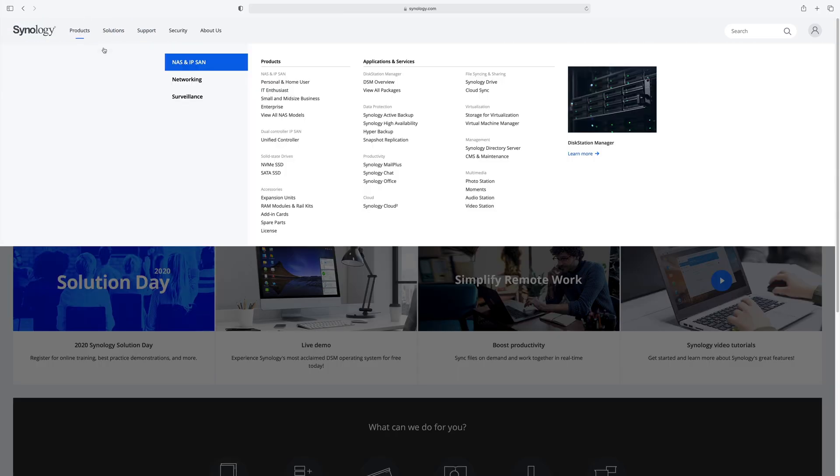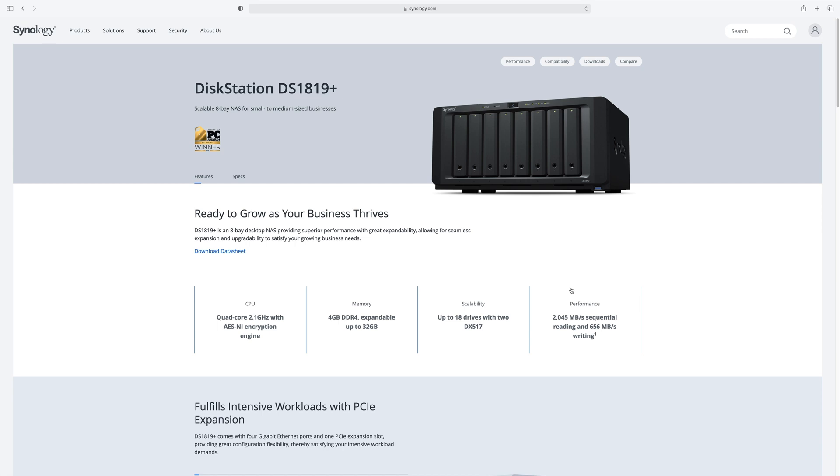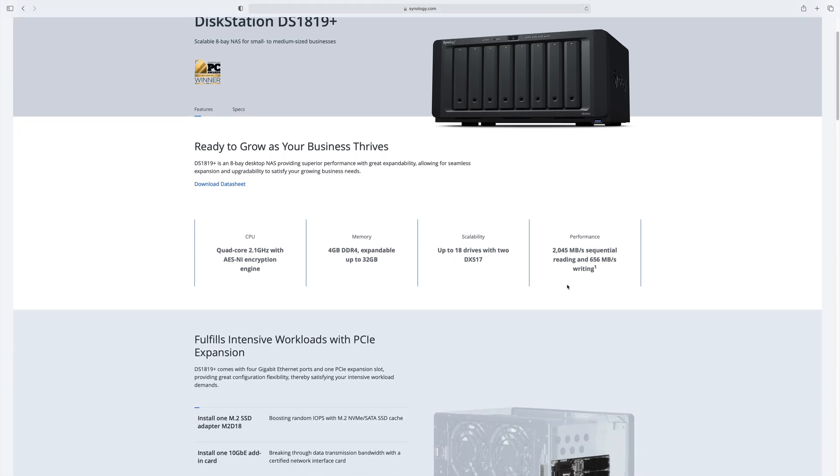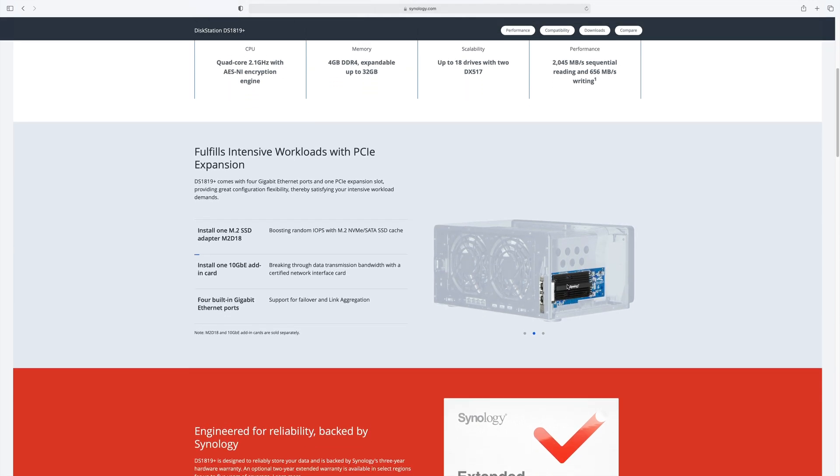What I'm going to go with is the Synology DS1819+. It's an 8-bay NAS with software that users apparently swear by, but most importantly, it can serve the computers at really high speeds. The iMac Pros come with a 10Gbps Ethernet port, and the DS1819+ has the ability to deliver those speeds through a 10Gbps expansion card.